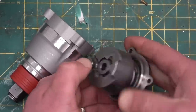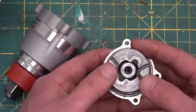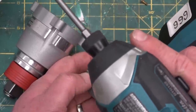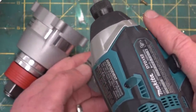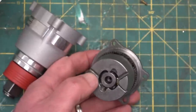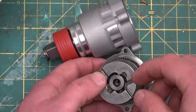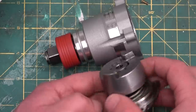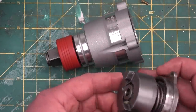And there is a timing issue, so you'll see we did a bunch of slow speed stuff, maybe with this guy. You could see that it needed to be timed, because if the RPM and the hitting of the anvils wasn't timed, you would get a double hit, and that second hit wouldn't have any jam to it.